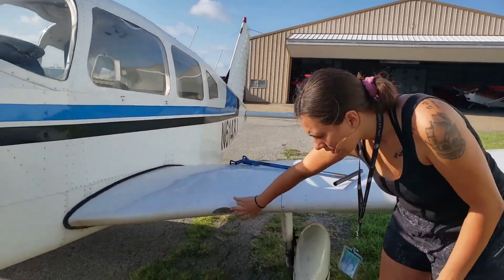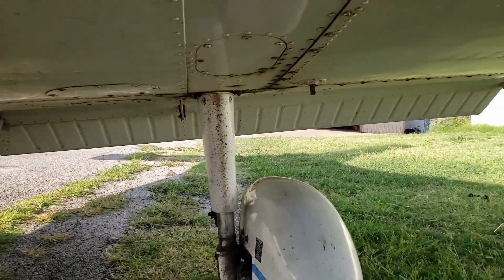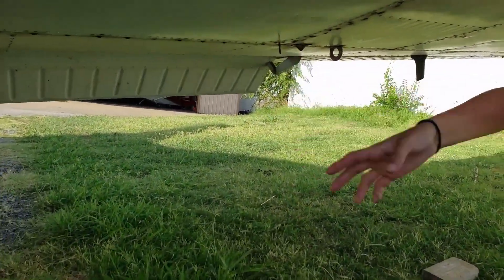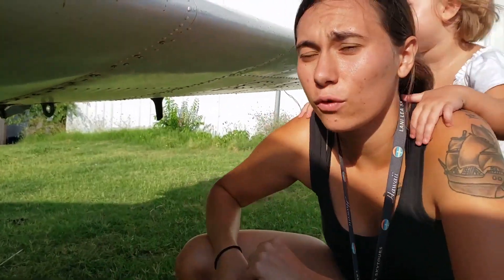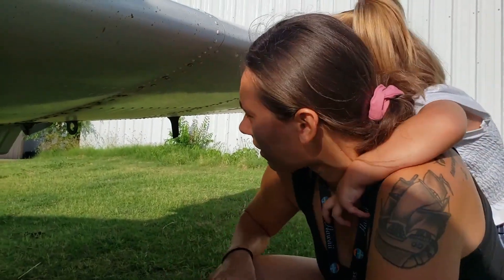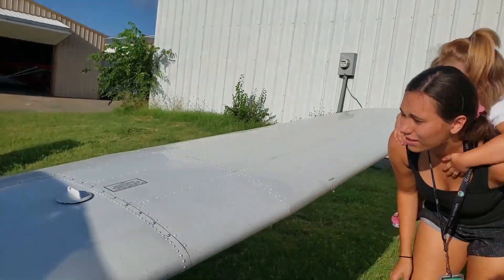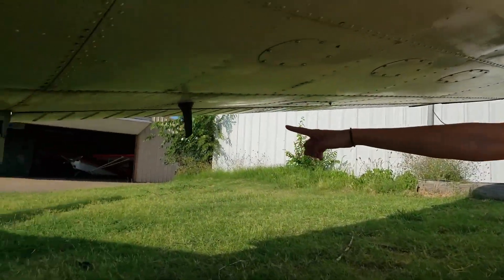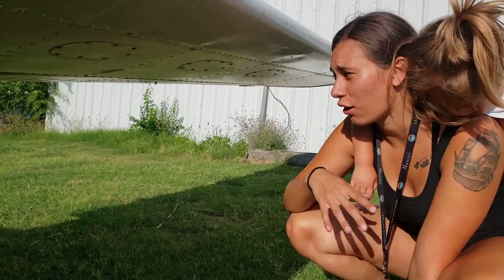There's your fuel vent — it keeps air flowing through. Fuel vent. We have inspection panels, making sure those are on. If there's too much fuel, or when the fuel expands and it comes out, the fuel will come out there. So from where do you get this fuel from? It's like behind you. It's the pitot static — so that's where we get our airspeed. That little hole: air goes into it and then it measures how fast we're going.